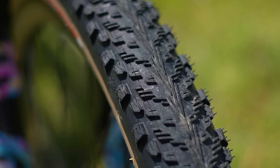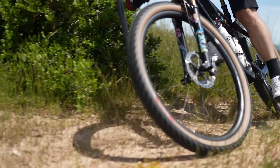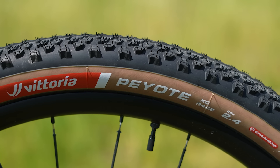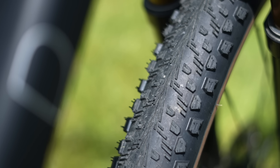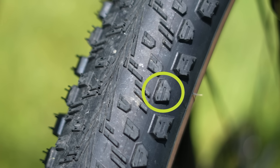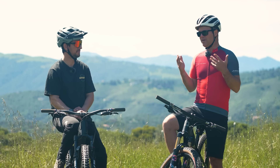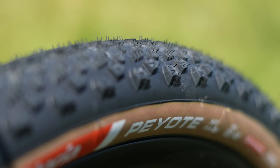Obviously on the side of the tire when you're cornering, you're going to be rolling over on the side. There's bigger, softer rubber there as well. The sipes — that's the cuts in those rubber knobs — you'll see a little slice on the knob surface of a tire. That is to enable directional flex, which is purposely engineered to provide an effective edge which will dig in or roll in a specific way.